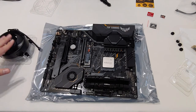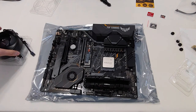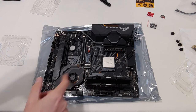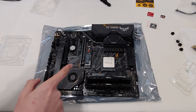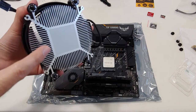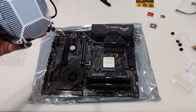We're now going to put the heatsink fan, or the CPU fan, on the CPU. Pretty straightforward, since we removed the brackets right before we installed the solid state drive, the SSD. Should make it a lot easier. You will notice there is thermal paste already applied onto the bottom of the heatsink here, so just be careful when placing it on there.